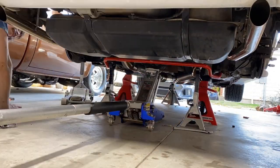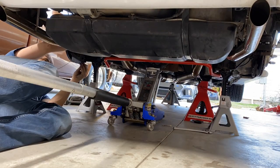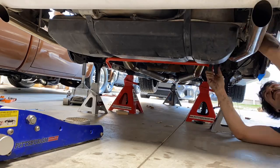Got the bolts back through — the next step is to raise the rear end up and get the control arms parallel to the ground. You want to go ahead, get your bolts in, just snug up the bolts — your springs still aren't in yet, you just want to put the bolts through the lower control arms. Then jack the rear end up from the bottom of the differential, get it level, and we'll go from there. Jack up the differential again, make sure you've got two identical jack stands to support the rear end. You'll see me going back and forth from side to side with my level, just to make sure the lower control arms are perfectly parallel and level with the ground.